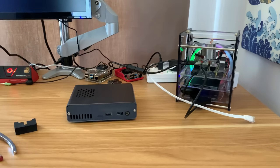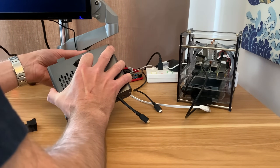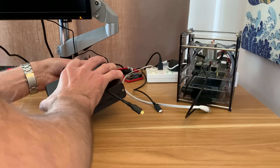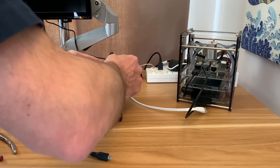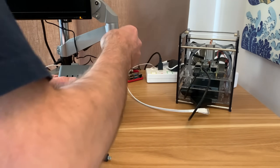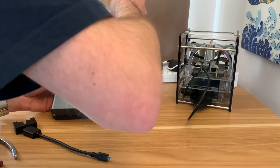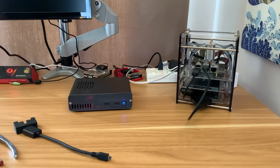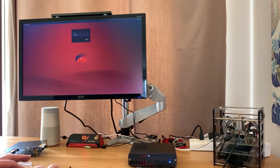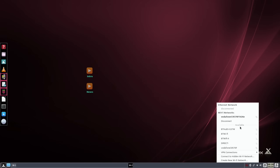I need to shut down Twister first. I don't need the micro HDMI adapter now. I think the HDMI port nearest to the USB-C is the first port, like it is on the Pi normally. Let's plug in the USB-C, USB mouse and keyboard - I'll plug that in the back into one of the USB 2 sockets. Let's use Wi-Fi since that was one of the things the upgrade was supposed to fix. There you go - that's booted up MX Linux. Let's log in and check that the Wi-Fi is working. The Wi-Fi is now connected and the drive is working.